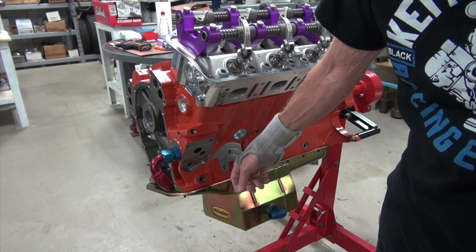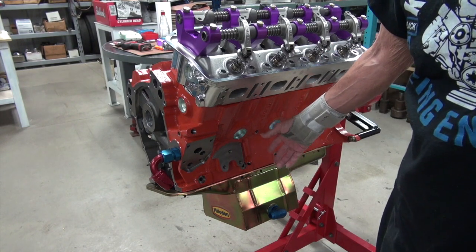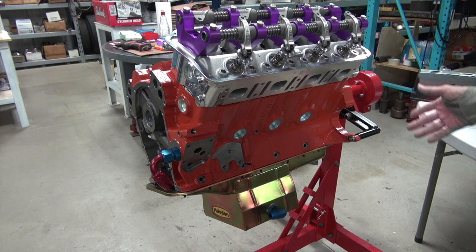All that port is doing is putting the oil feed in here instead of coming up from the pickup. This is a simple line with a simple pan and a static pickup - nothing fancy, just something to get the thing started. I don't even know what kind of car this is going to go in yet, so it's hard to pick a proper oil pan and oiling system.